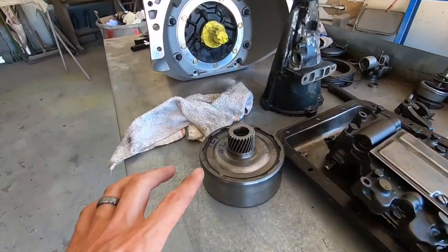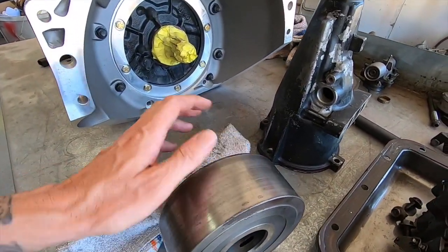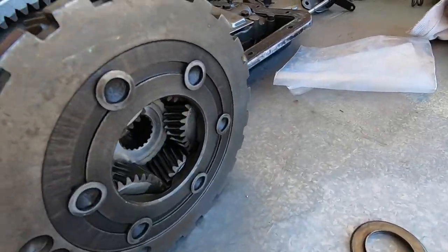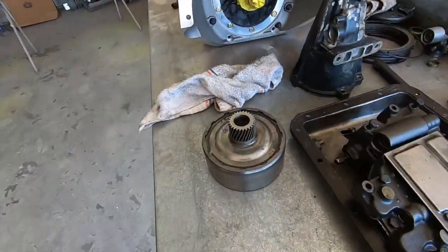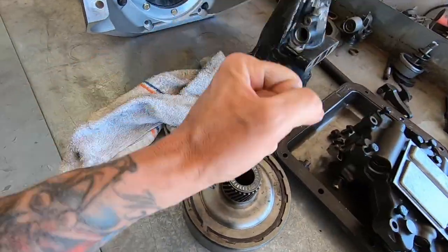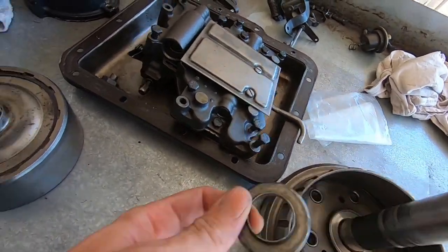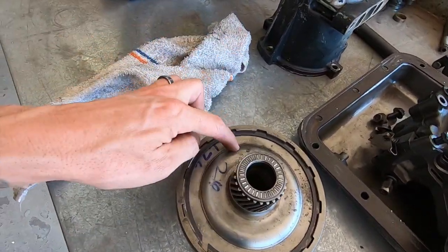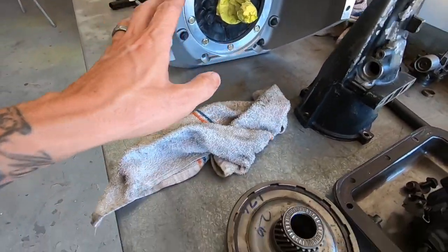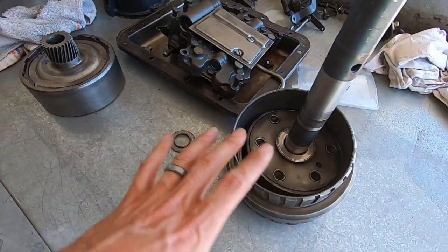This portion meshes with the teeth and gears on this, so you will need this portion to make the 182 gear set work. This is the same drum that I had for the clutches and steels which is my high gear right here, but this top portion meshes with the gears inside there - that's where this guy lives when it's all assembled. This slides over the top, meshes, and rides against this bearing. This is called your sun gear. Everything below this is all actually out of this transmission - the only thing that was changed was this portion here.